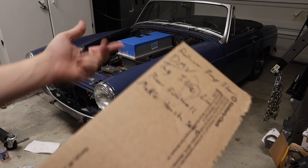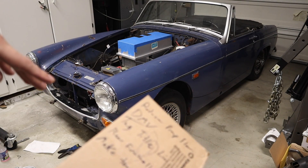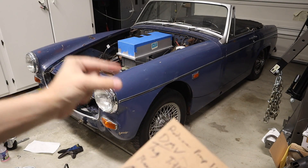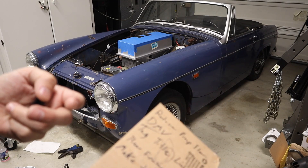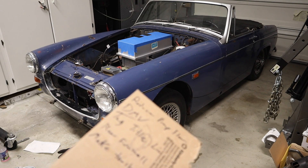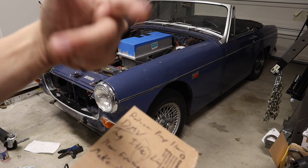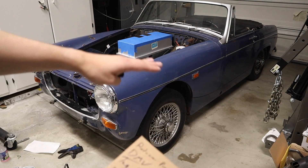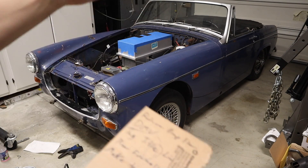Make touch safe. Today our camera girl joined us and where she was sitting she was fine with adult supervision. I knew that so long as she didn't pop open the contactor box, which she could physically do if she reached down and undid the latches. So I need to put a small lock on that — or even a zip tie, just something that would keep a normal person out of there for risk of electric shock. Kids get curious and start messing around with stuff — I need a barrier of entry that keeps them from shocking themselves. I think that's the only piece in this car that's not touch safe. All the stuff in the back is covered up. There are some exposed fuses, but that's all on the negative side, so if you touch that you're just touching the negative-most point of the battery pack. I might put a sheet of plexiglass over the whole thing and create a false floor above the battery pack.